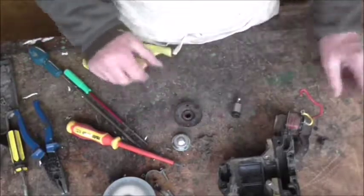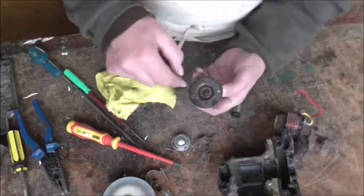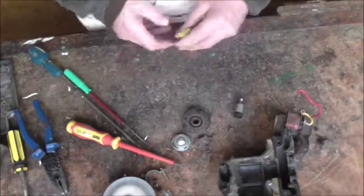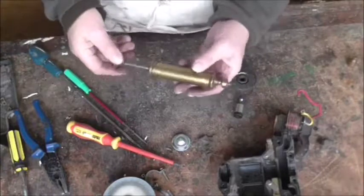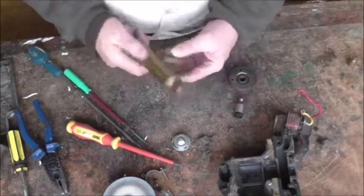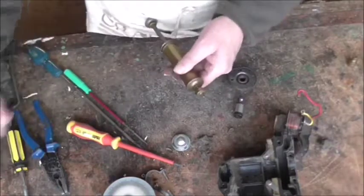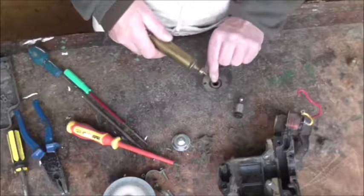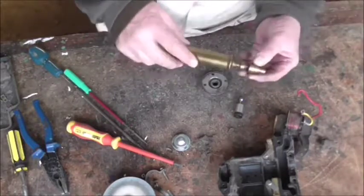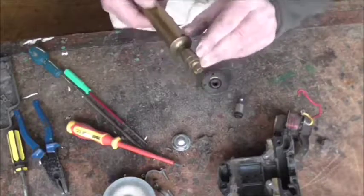What we've got to do is lubricate that bearing. You can't lubricate it easily because it's a ball bearing inside a pressed container, so you need a special tool - a Hoover grease gun. Here it is - the official Hoover grease gun, which you can't buy in shops although they do appear on eBay. It's a genuine Hoover gun made especially for servicing their machines. You need one of these nozzles - there's a large, medium, and small. We need the medium one, screwed on like so.